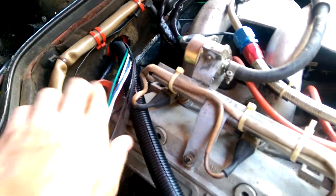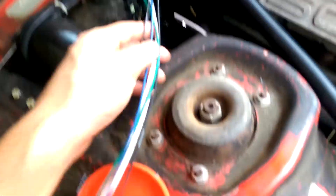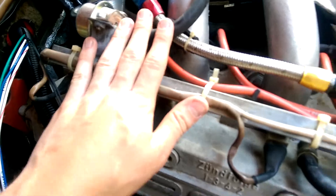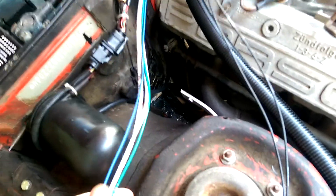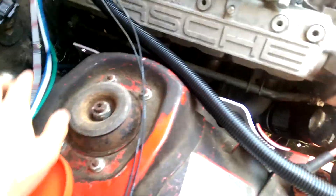So I kind of have two sub-looms coming out of this one — it branches. The first branch: these two black ones are grounds for the injectors and the ignition coil packs, which are going to be mounted here on this solid but not very smooth-looking bracket. The rest of these are just for the ignition and injectors — the grounds for those and the signal wires for the coil packs. Since the coil packs are going to be here and the injector harness is up here, it's all going to be in this area.